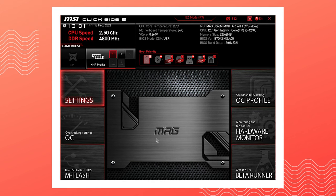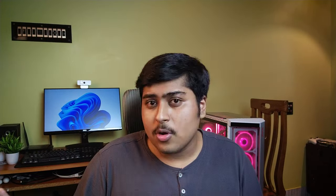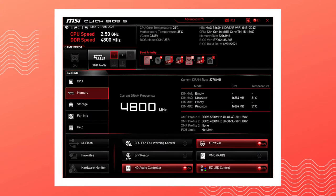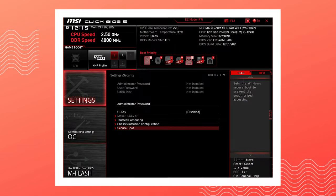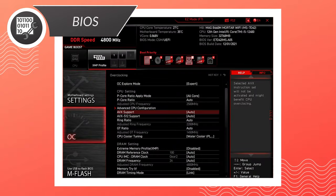Time to boot. I like the way MSI has designed the BIOS — based on American Megatrends firmware but with a commendable custom GUI. There's an easy mode and a regular mode (F7 key). Easy mode covers basics like CPU frequency, DRAM frequency, and XMP info. The overclocking section has a normal mode for beginners and an expert mode for pros — it has everything. MSI's Memory Try It feature speeds up the overclocking process too. I had a wonderful time overclocking and give the BIOS a solid 8.5 of 10.